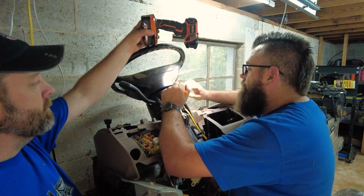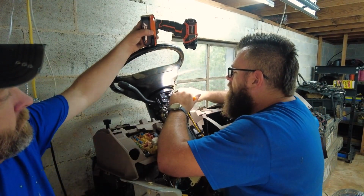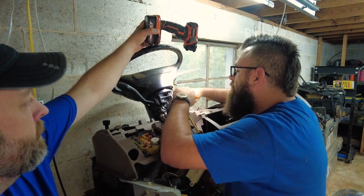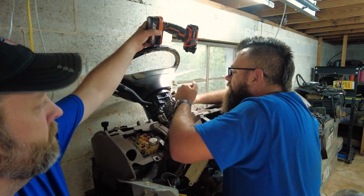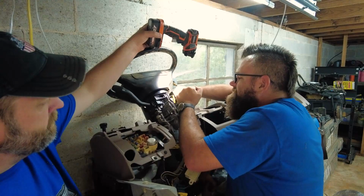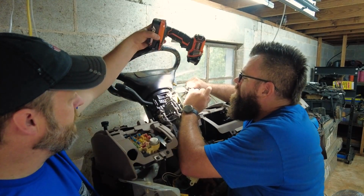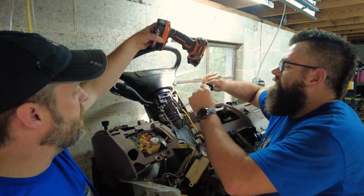So we actually need this shroud because this shroud is part of the automatic transmission, but not part of it, it's part of the steering column and we need it. So to do that, you got to put the key in, rotate the cylinder to a point and pull, and there's a little teat that you got to dip and then it pulls out. Right there is the piece I'm looking at. Are you pushing in on that? Yeah, I'm pushing down on this as it rotates and pulls out. Got it. And that's the lock cylinder.